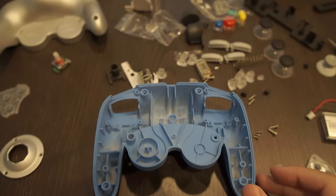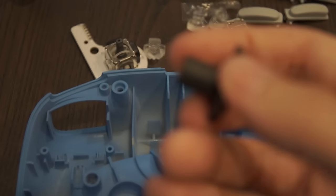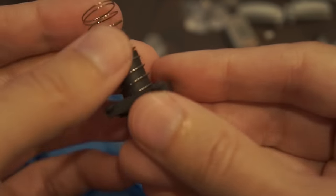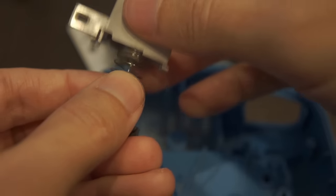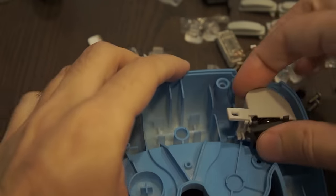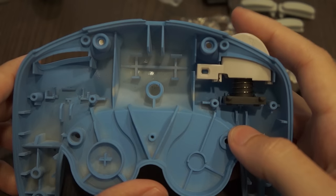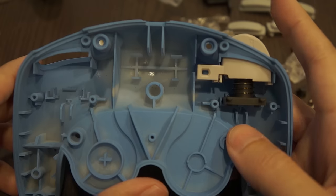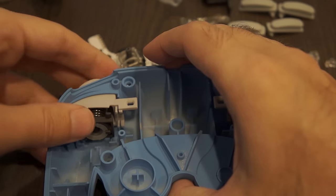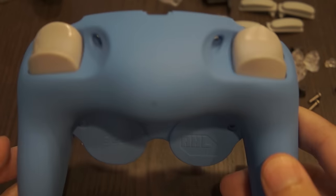With that, let's continue the assembly. I'm going to install the original triggers — I've got these light springs and this little membrane trigger holder. I've already got the membrane installed; all we're going to do is just tack that on, put the trigger in place. This works just like the original controller would. I'll go ahead and do that for the other side as well — the spring tension holds itself in, making it really easy to use.